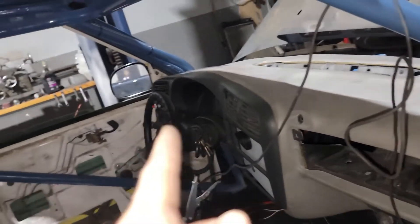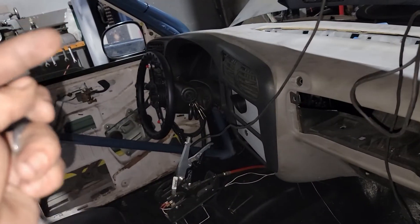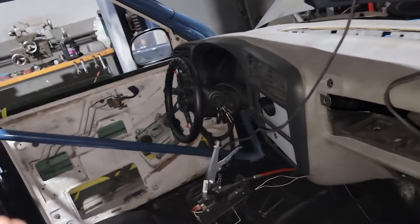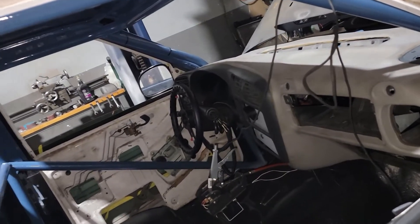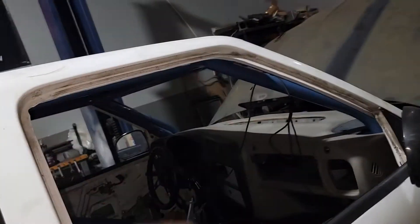Also, the relay — I made a mistake in a previous video. The nitrous relay wasn't triggering, and I literally forgot to wire the ground. In a relay that would be pin 30, your battery positive. In this case I reversed the relay, so I was feeding in a ground to feed out a ground to the Holley. I found the wire, hooked it to a good ground, and that works now. I verified it works in the software. I was playing with the truck on the phone with Jeff, so everything's back together and the dash is back together.